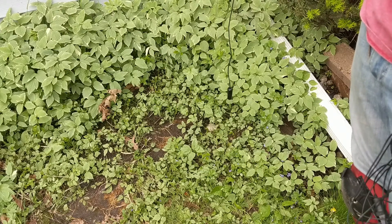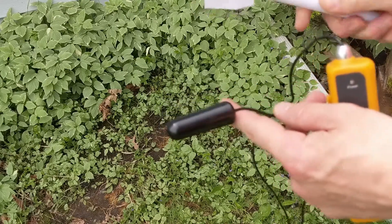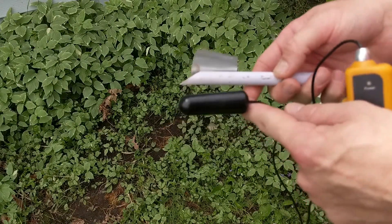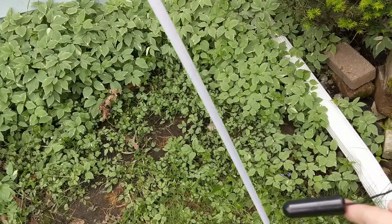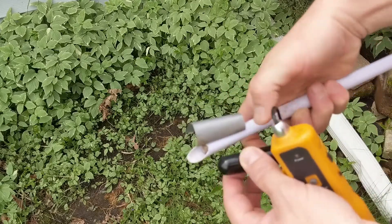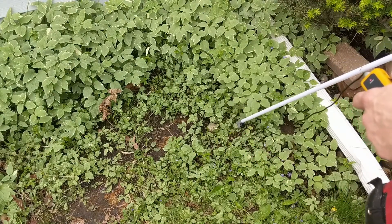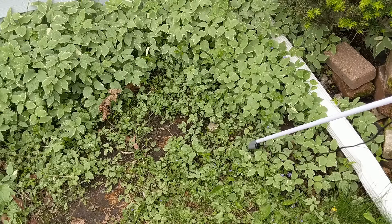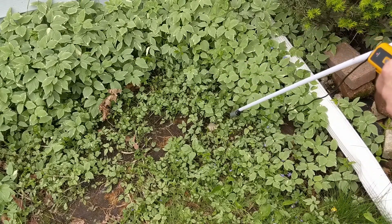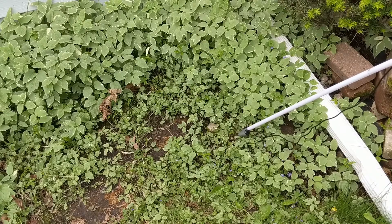You have to be right over the wire to get that tone, and if your wire is buried it's even harder. Since I had a dangling receiver wand that was swaying back and forth, I grabbed a piece of PVC pipe we had laying around, used some duct tape, and attached the receiver to the pole. That way I can hold it steady while walking. I just keep walking around, listening for the tone until it gets really quiet or disappears — that's a potential area where there's a break.